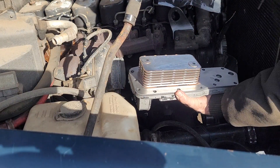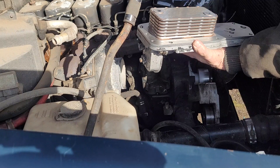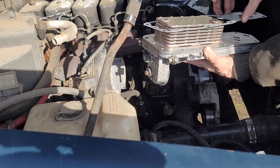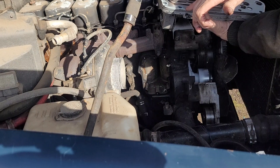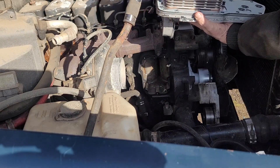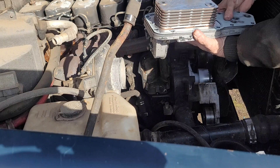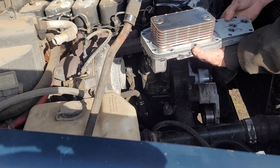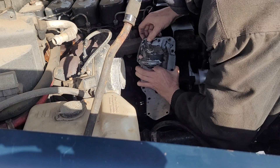Then plop that heavy guy on there like that. I put the Right Stuff sealant all over it because this part is water-side. The gasket only has this little dark area around it — you see the darker gray — it doesn't even go all the way around the bolt. So we just added some more silicone. Down here they had the part number stamped in where my thumb is, and on the other side it was dimpled — I had to do some body work on it.